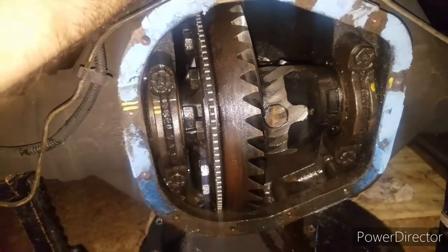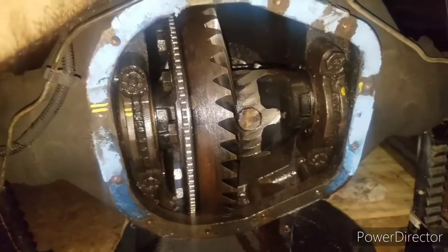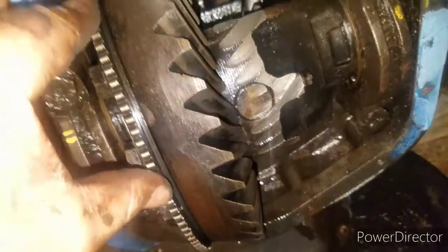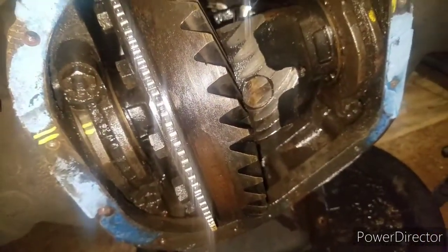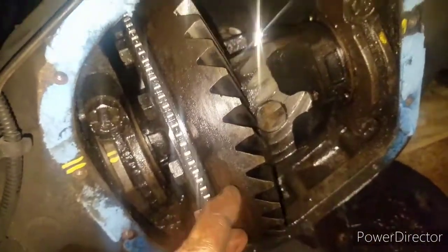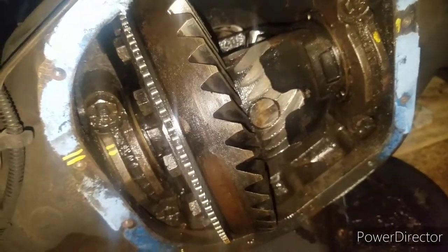Alright, sorry for the part that I skipped. I had some company that was over. So I used a gauge to set my backlash. It's like at 8 thousandths or something like that, I forgot, because I did it and left it alone instead of recording it. I was inside the house.